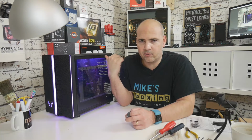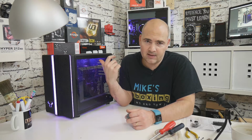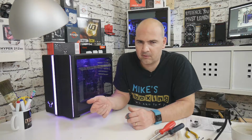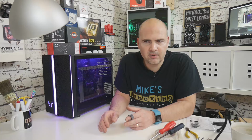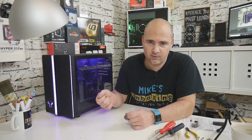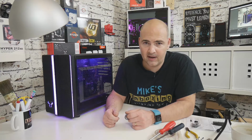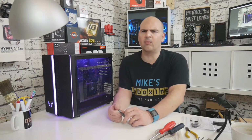There is a very residual current which still comes through there sometimes, even if you have got the power switched off. If you had the cable disconnected as well, then I don't know, unless you were getting some kind of back feed of power from a USB 3 or USB 2 device, if you've got anything connected. Some powered USB hubs can back feed power into the motherboard, so that's a possibility. But if you put a screwdriver on the short circuit pins, that generally will counteract any of that power coming back into the system. Hopefully that answers your question a little bit.